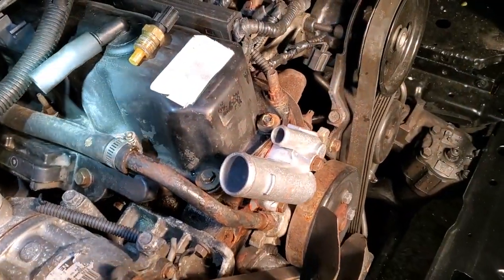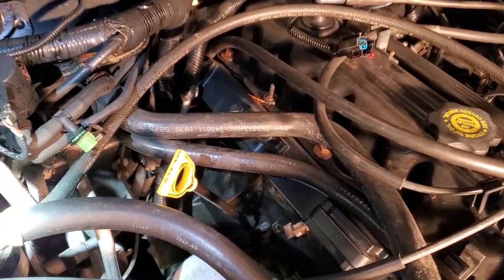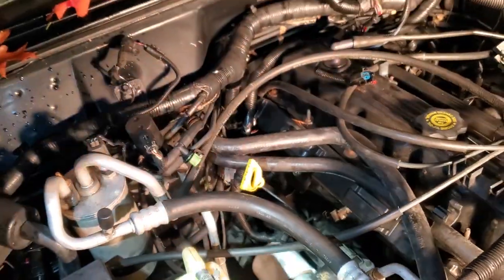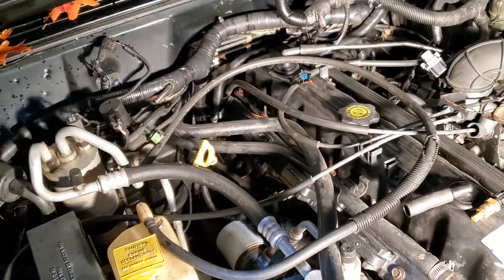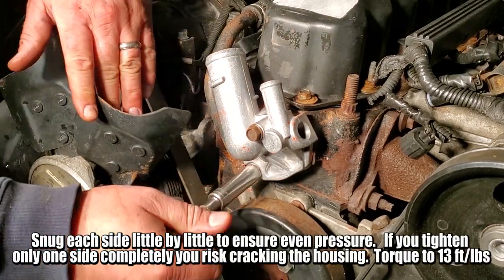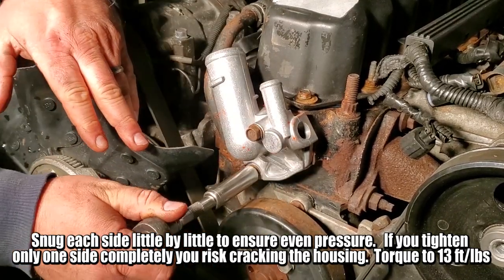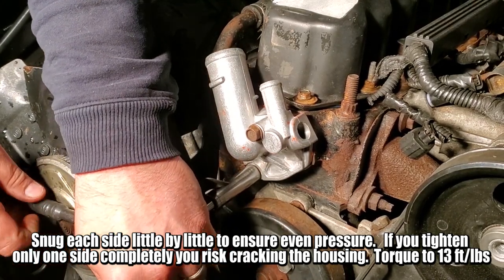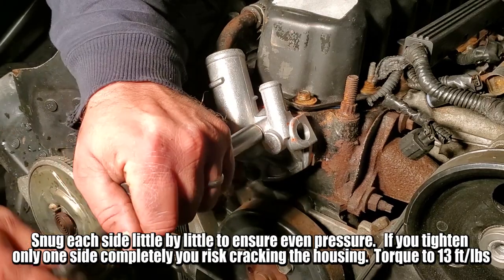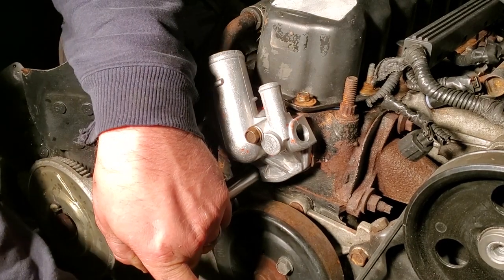While I was waiting for my gasket to firm up, I went ahead and tightened up some rogue valve cover bolts that had worked themselves loose, and replaced a broken dipstick. Alright, 13mm — I'm going to crank down each bolt little by little, making sure it seals up nice and even. You don't have to go too hard — it should be on there nice and flush with two layers of gasket maker and a paper gasket. Not too tight.